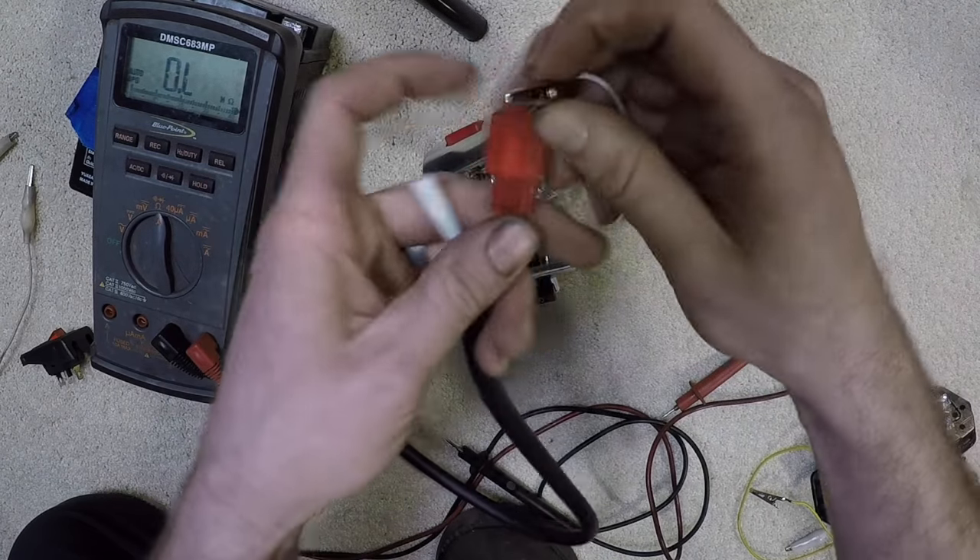What the wiring diagram will show you is that the starter button relies on a couple of different things — we call these safety switches. Clutch switch on some bikes: some bikes won't start without the clutch pulled in, even in neutral. Neutral switches, kickstand switches — just to make sure you can't start your bike and take off with the kickstand down or while in gear without physically doing something to change that switch. Like, if you were in gear with the kickstand up, pulling the clutch in, and starting it, it'll say okay, he should be aware he's holding that clutch in. Trust me — you do not want to ride a bike with the kickstand down and make a left-hand turn.